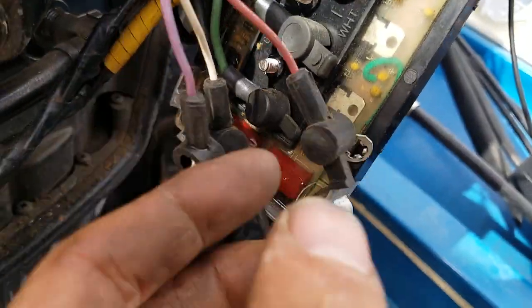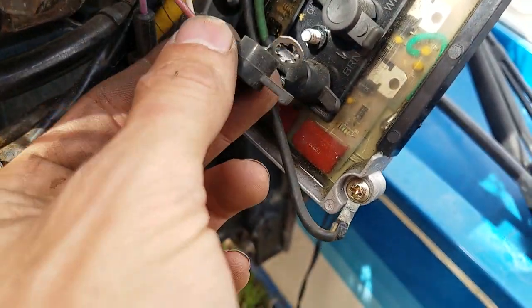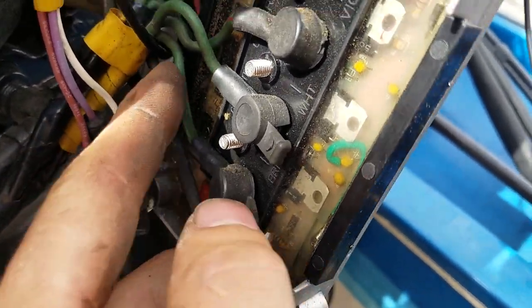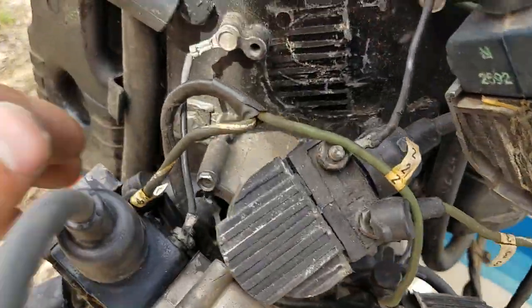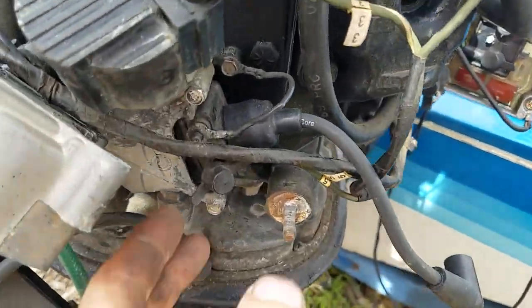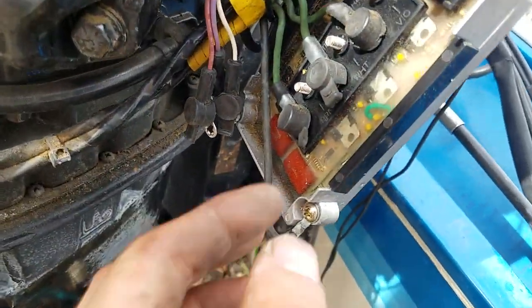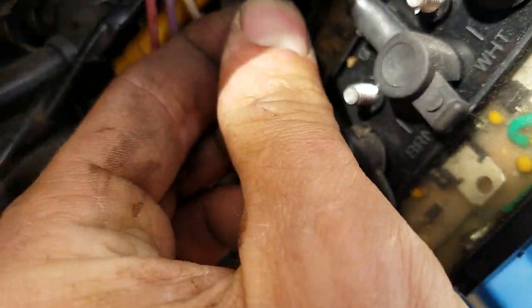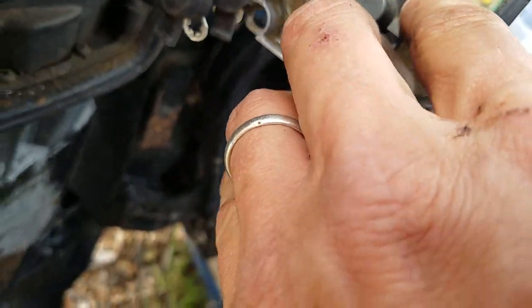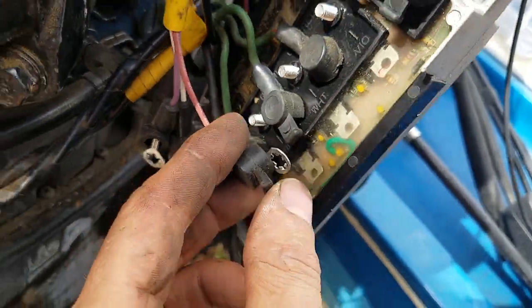You have the incoming trigger wire — there's BRN, which stands for brown, which would be this wire over here. That one is going to have to match the coil wire that's completely green. On this side you can see there's green and white, there's green, and there's green and red. The solid green coil wire is cylinder number two. So the solid green here is cylinder two, and it's safe to say that brown, which is adjacent to the matching coil wire, is going to fire cylinder number two.